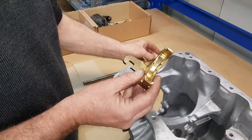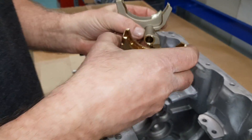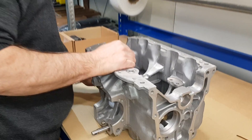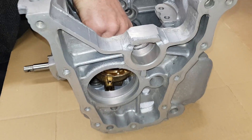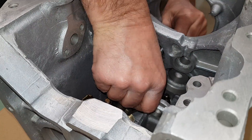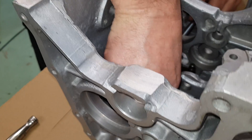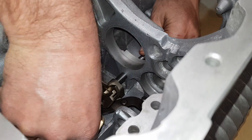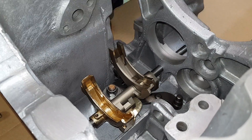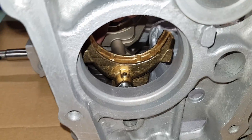We've got two new selector forks here — they sit on like so, so we'll drop those into the box. Now I'm going to put the shaft through; in we go. We'll lift the selector fork up just to locate it on the shaft — there's one on, come out the other side, there's the second one on. They're now in place. Make sure that they are located on the shaft and the selector arms in the bottom of the gearbox.